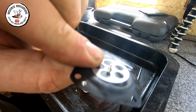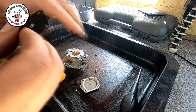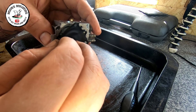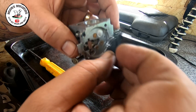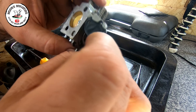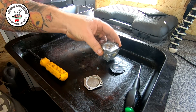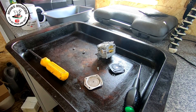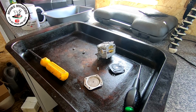This is a very common problem with these. On this diaphragm there's a little tiny dimple on the top — that dimple sits inside that little tiny groove. And I think it's just been pushed on top rather than clicked in. So that needs to go into there so you can't physically pull it off. And no gasket — so that diaphragm, there's no way it's going to flex the way it should with no gasket or spacer on there. Fortunately I have got a spare kit.